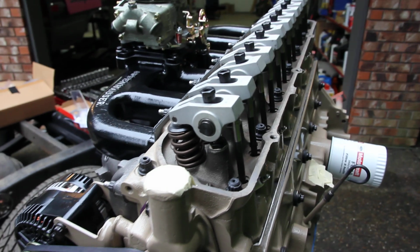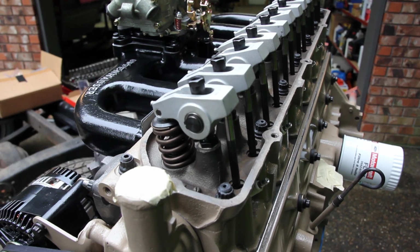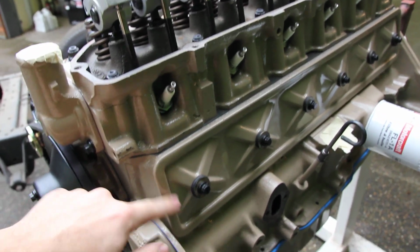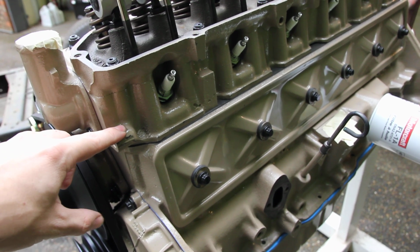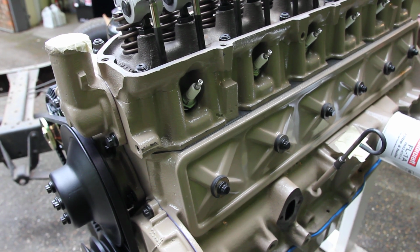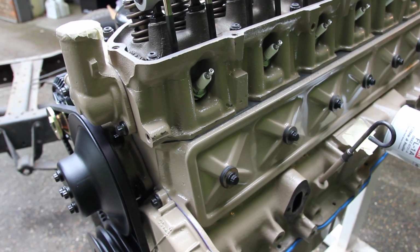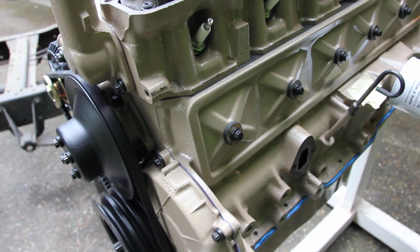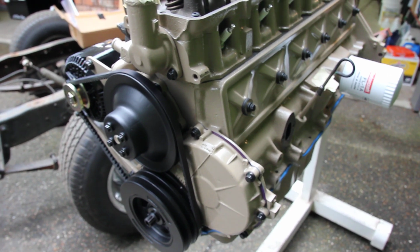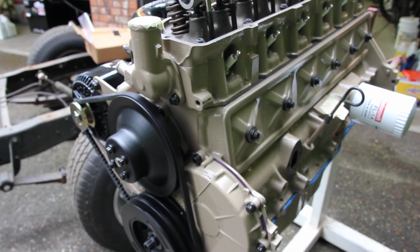Let's start from the top. We have roller rockers for a Chevrolet 250 inline 6. We have studs for a big block Chevrolet. We have oversized valves for a small block Chevrolet. We have custom push rods going to Crower lifters with a custom camshaft. We have Probe forged aluminum pistons for a small block Ford stroker, so a 331, 347, that kind of thing. Connected to 240 inline 6 Ford rods to a 300 crankshaft. Tried to find a forged crank, couldn't. I'm not too worried about it. It's got 7 main journals, studded, and a fully balanced engine, so I think I'll be okay.